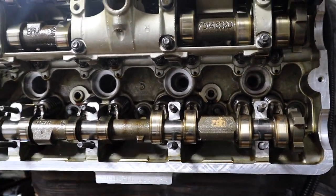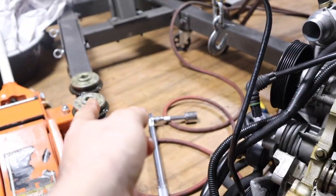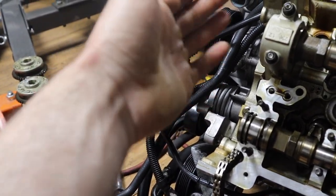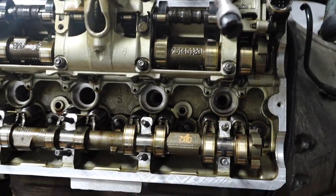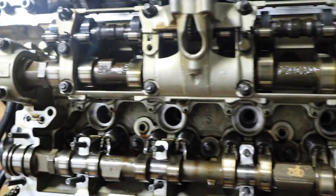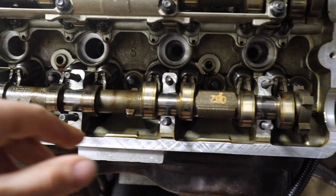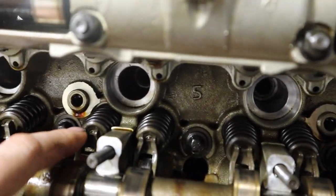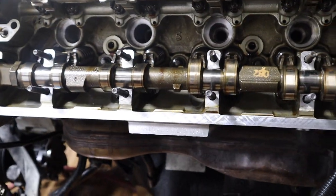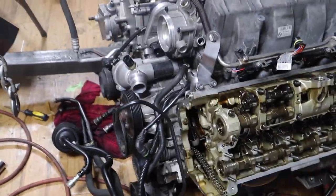Once we put this on, we're gonna torque it again, same spec, 10 pounds. Then we're gonna put the gears, and the gears have labels. On the exhaust side, it says EX, and intake says IN. Make sure these lobes are facing up. The same goes for the other side, the passenger side, the cylinder 2 lobes, make sure they're facing up. Here it doesn't matter, but here it does. And make sure all the rockers are in place, so they're not misplaced. Now we're gonna lubricate the caps and install them. All right, easy cheesy, lemon squeezy.